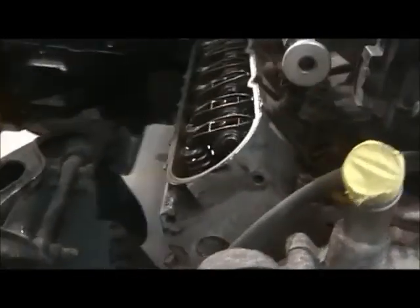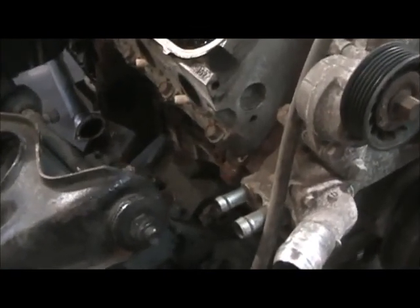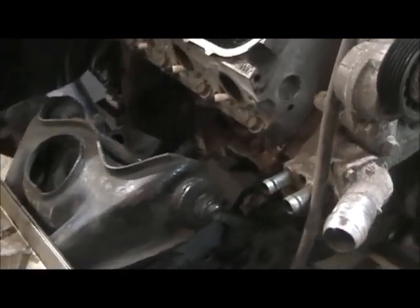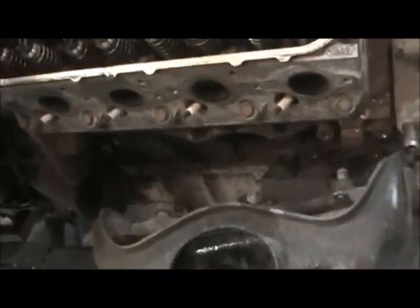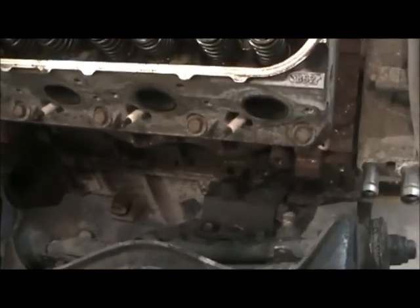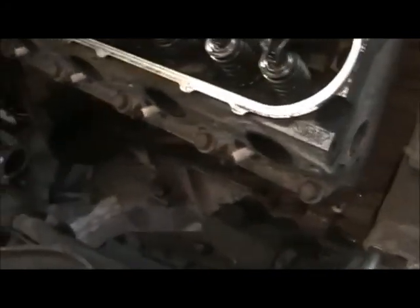I wanted to see how the motor mounts were going to work out, and I can't tell because of the oil pan. I can't get it down where I need. I did see online guys that made their own. They're pretty simple. I looked them up, saw some pictures of them. They are pretty simple, just a piece of 1/4 inch plate with slotted holes with 2 brackets that come down, and you use the original motor mount. So I did price them. They run anywhere between $60 to $200. And I don't know which ones I need. So I'll probably make those, but I really gotta find an oil pan.